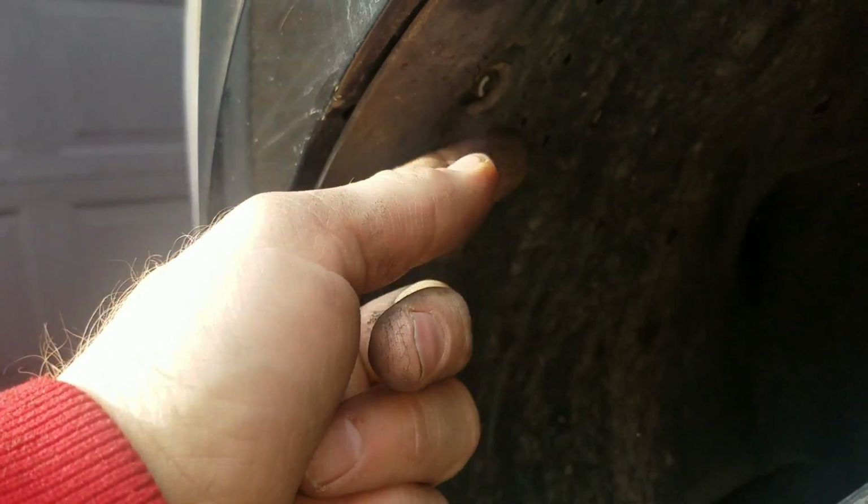Then you have to come down to your side of your wheel here. There's a bolt that goes right here, which is 7mm. Take that out. Then you got to pop these tabs off, which I have never had good luck with those tabs. As you see, I broke mine, and I really don't care. What I'm going to do is take a self-tapper, because this is all metal, and I'm just going to run a self-tapper in there and take a Sharpie and make it black, or a spray paint, what have you. That way I can always get it back out when need be, okay?